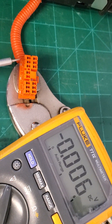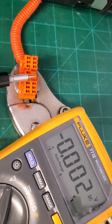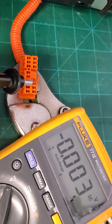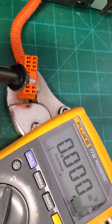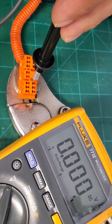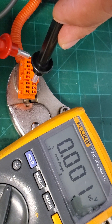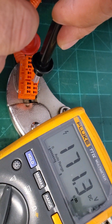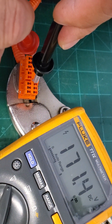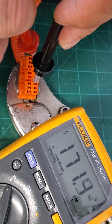We'll start by identifying which pin is the high voltage negative (ground) and which is the high voltage positive. This pin right here is pin number one — that's your main negative. And this corner pin on the top left is your main positive. You should get the full reading of the battery pack right there. Always practice safety and don't short out your probes, or you'll damage things and create lots of sparks.